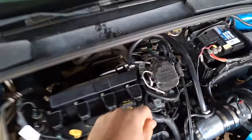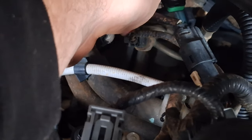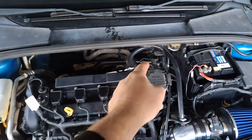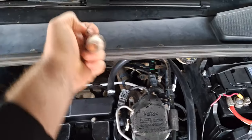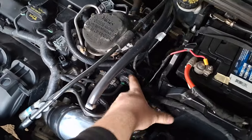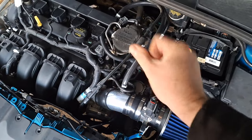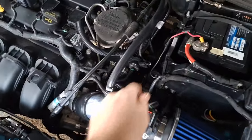On the Ford Focus 2-liter engine, there is a fuel pressure sensor right here — my finger's touching it. That's a common failure, not extraordinarily common, but if you want peace of mind, you can get one for about $80 at the Ford dealership, and that would be one less thing to worry about. Next: the purge valve — replace it. Get a brand new OEM purge valve. Those cause leaks and can cause the engine to run lean or rich if it's pulled liquid fuel into the canister. That's a very common failure, so replace that to bulletproof your Focus.